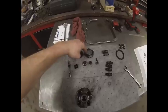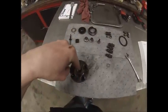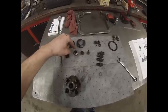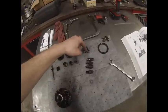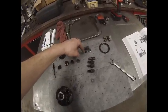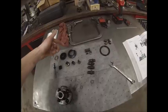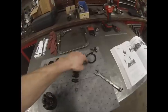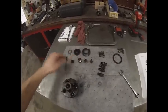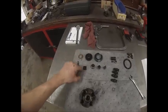That's the main plunger. That's the timing gear and timing gear cover. This is the little fuel delivery plunger which sits inside there, and then that whole thing sits in there. That's the retainer for it, and that's the plug and return spring. The plunger is held in by basically the same sort of top hat retainer and keepers as a valve in an engine head. I was able to get a valve spring compressor to clamp tight enough to catch that top hat. Then you've got two O-rings, copper washers, and an O-ring on the control assembly.